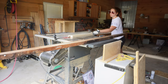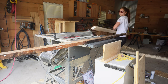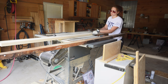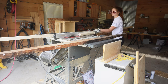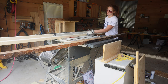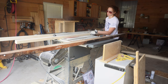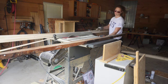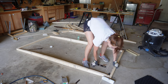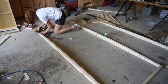I also need some pieces for the sides, so I'm cutting these at an inch and a half. I measured the very ends of the arch wood and it was inch and a half, so I went with that because I wanted it to match up with the existing aluminum framing. My plan is to basically make a rectangular piece of framing that will just sit in the entire roof of the camper, and then I can screw the side pieces in to the existing aluminum framing.